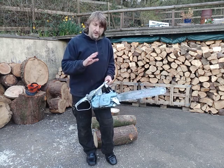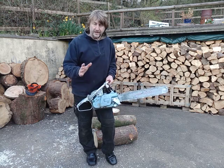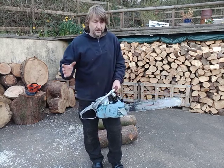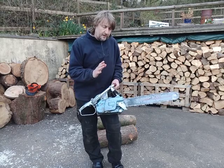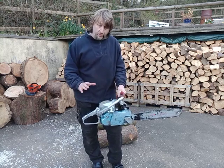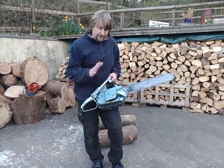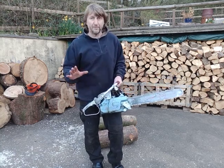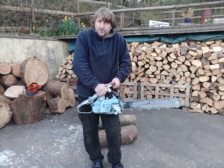But strangely, when I put the Teflon pump into my first 71, because the engine's short stroke and very, very hard revving, in comparison to the 480 Huskies, almost any of them are longer stroke engines than this in this capacity, it really works well with the acetate. The increased pumping ability seems to suit this engine really well, and makes it, I would say, perhaps even more responsive. As a side issue, if you are ever looking at upgrading or changing your pump on your 71, then you might look at getting a high quality Teflon pump. Mine was from one of the UK providers, was around £9, and I'd say it was an eye opener. It just makes the engine run beautifully.